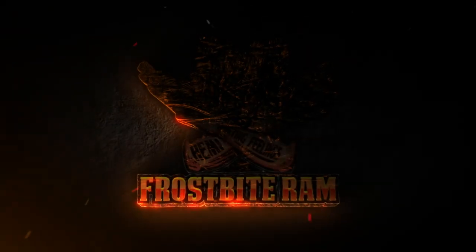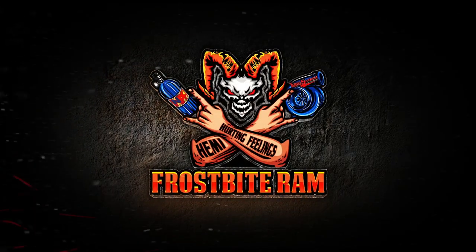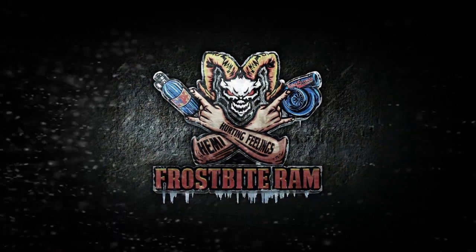So today, we actually have a problem. Our 2015 Dodge Durango actually just threw a check engine light, and it is a P0128 code, which usually means it's going to be a stuck open thermostat most likely. So we're going to be tackling that job today. We're going to be putting in a new thermostat, clearing the code, and hopefully that'll resolve the problem.